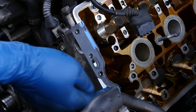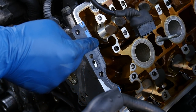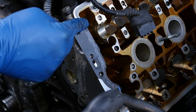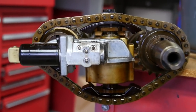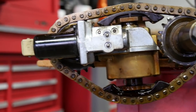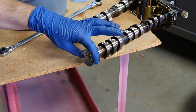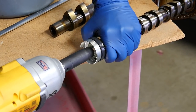Another very thin layer on this inner edge of the gasket — it's probably overkill but better safe than sorry. Before you grab your camshaft chain tensioner and put it back on, you should clean any surface area that's going to come into contact with RTV silicone. Something else you need to do is remove this metal cap for your camshaft position sensor while you hold onto your camshaft.